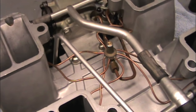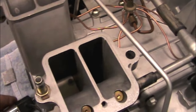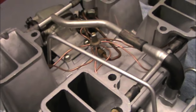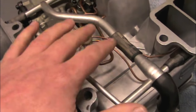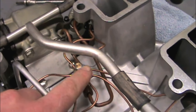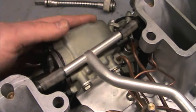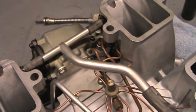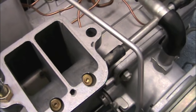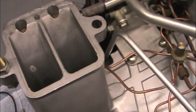It's a really good idea to install one of these anti-siphon valves — just a safety thing. It will potentially prevent your engine from hydro-locking. These fuel spiders have a tendency — there's a valve inside here, and inside the fuel meter there's also some anti-siphon stuff — but that is not the most reliable, and you don't want your engine filling up full of gasoline.